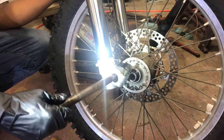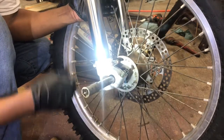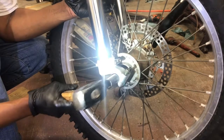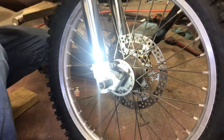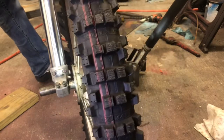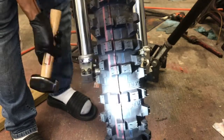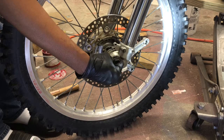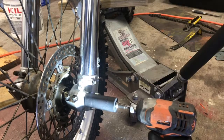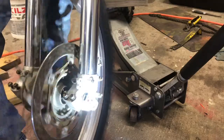Alright, so we're on the right side of our bike. We're going to start with your stud — go ahead and work him in place. You may have to give him a little tap so he can fall in place and get lined up where he needs to go. Definitely want to keep an eye on the back side with your jack. We're going to go ahead and install our nut. Lift your bike up, wiggle side to side, give it a turn.